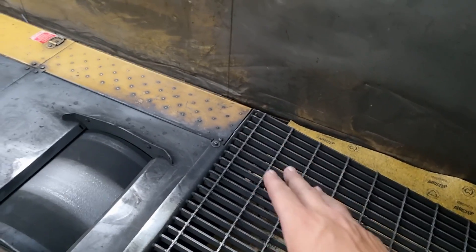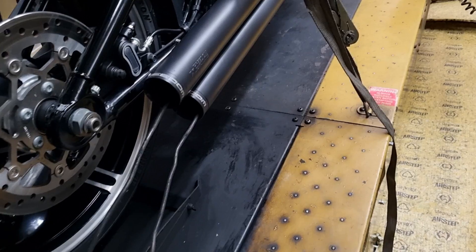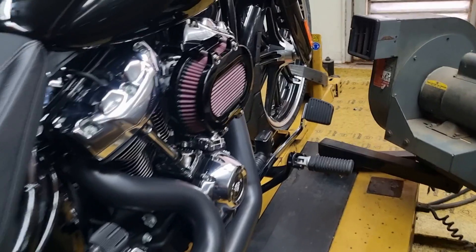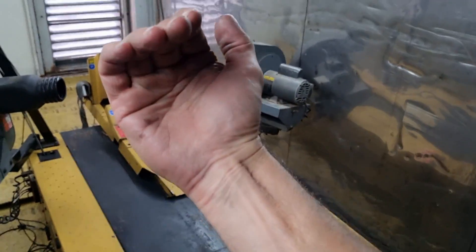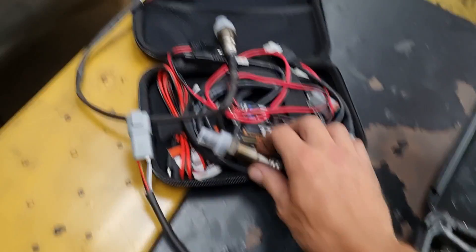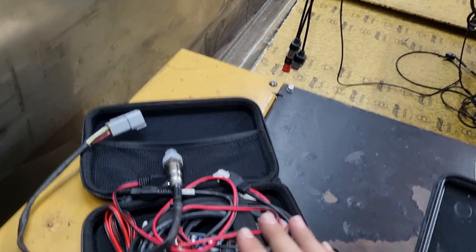Now that is not the most accurate way to do it — that is the easiest, quickest way. It works great on some shorter exhaust systems that are very short and don't have weird shapes in them. As you push those up into the bike they will bend and go around the corner slightly, so they get pretty close. A more accurate way to do it is to get our wideband O2 sensor as close to the exhaust port as possible.